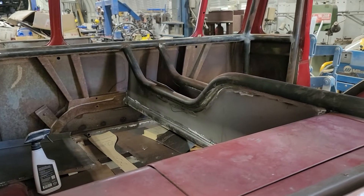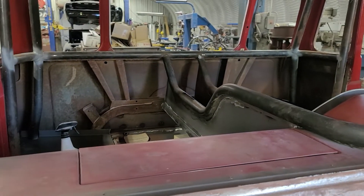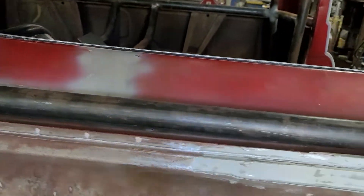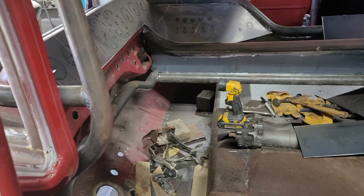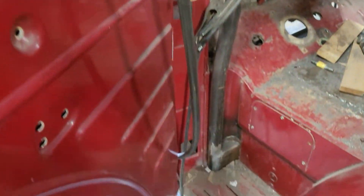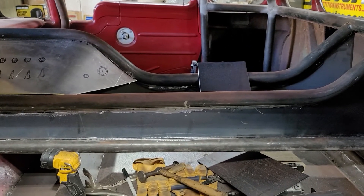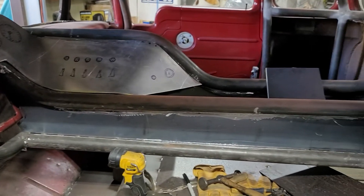One of the big problems with these big flat-nose COEs is that a frontal impact is pretty devastating — it either throws the passengers through the windshield or caves in the front on your legs. So the roll cage definitely stiffened up that front end, gave it a little more protection. That roll cage goes all the way down and ties into the frame, making it pretty stout. It's 16-gauge metal, so it's like a girder down the center of the cab — makes it a lot stronger.